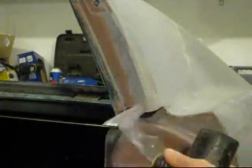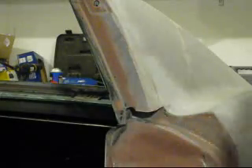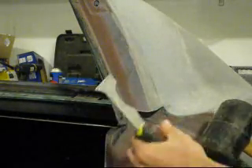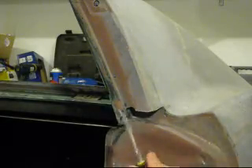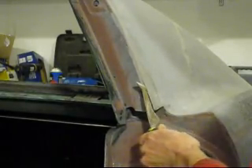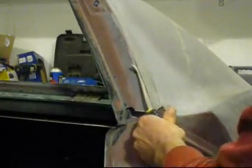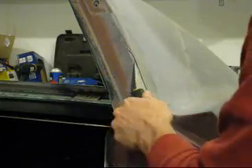Working quickly but carefully, I'm going to use my 5-in-1 tool with a rubber mallet just to get started. Once it's started, we'll be able to separate the panels using a thinner, more flexible putty knife just with hand pressure — that's how easily this will come apart. I'm going to set the blade about a sixteenth of an inch in from the edge, which is about how thick these panels are. You can see right here that it's just splitting right apart — that bonding compound is releasing quite easily. You'll notice you don't hear any cracking or splintering of the fiberglass. Everything is coming off in one piece, which is working really nicely.